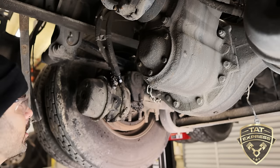So I mean it's doable, but sometimes the rod is gonna be so long, it's gonna be out here, you're not gonna be able to get everything out of the way. So this is how we've always done it: removing the brake chamber, measuring it, cutting it, putting a new one on. Most of the time we use the truck to release the truck brakes instead of putting the cage bolt. But since this is in the air, this is how we're doing it.